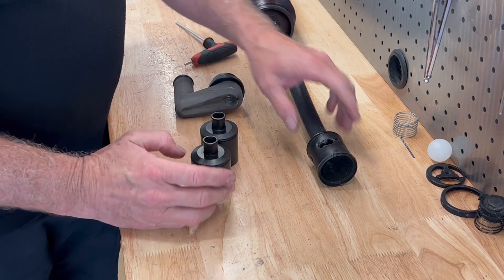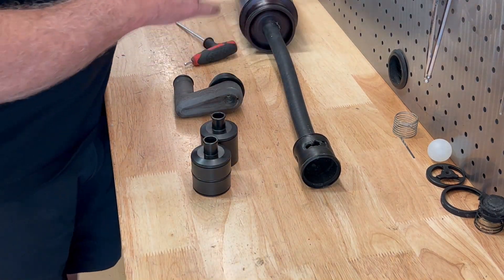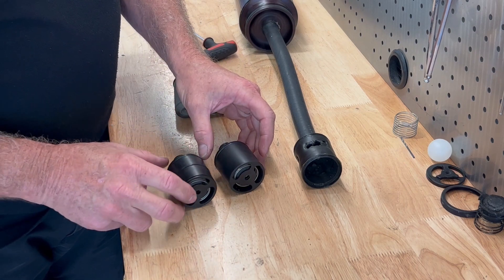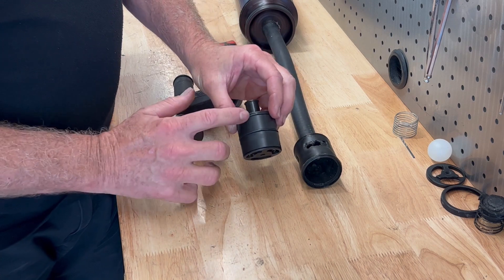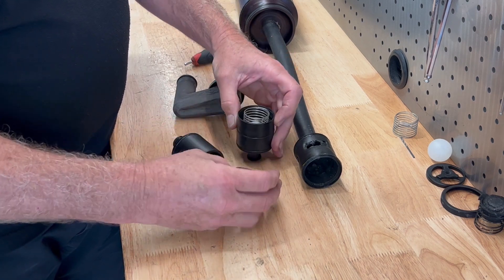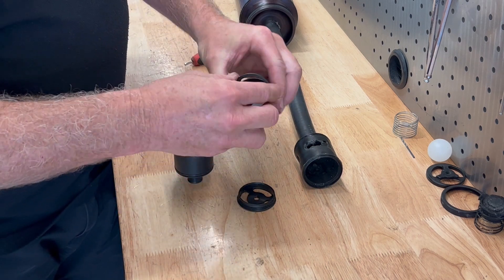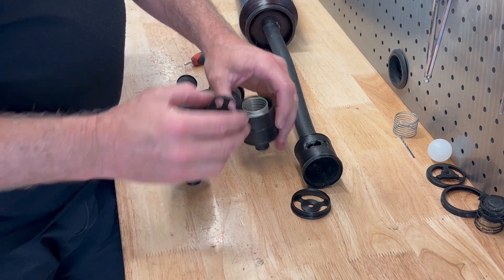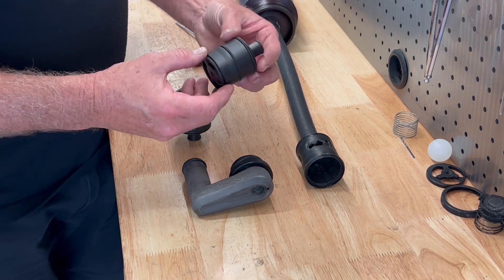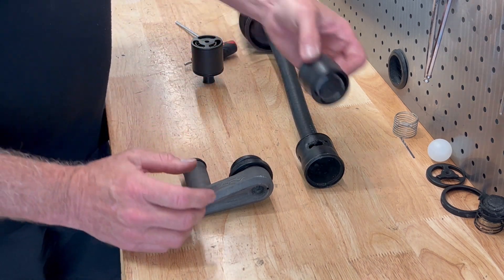Another thing to show you — these exhaust ends: in a lot of cases you can burn the exhaust end or damage the ball while the rest of the pipe is fine, so you might just need to replace the end. There are two ends to look at: the new ends supplied by JetSurf have two o-rings on them, and the older ones had a single o-ring — they're slightly different with different thread sizes. If you take the new one and put it in an older pipe, it's too big, and vice versa. So if you ever want to upgrade to the exhaust silencer, make sure you have the valve with the two o-rings on it.